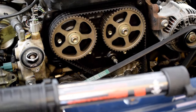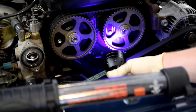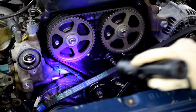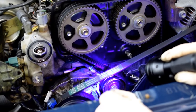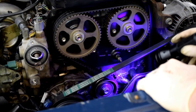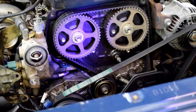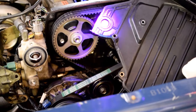Now we're getting somewhere. Here are the cam gears, and right there you can see a stream of residue that lights up pretty good. Looking right below it on that timing case — that's coming in pretty good. So if it's glowing below that, it seems like it should be coming from above, which would make sense if it was that cam gear seal right there. As we follow it down, there's obviously more as it goes lower. And pulling off the bottom cover, you can see a lot of iridescence right there because that's wet oil — so that's where part of our leak is coming from.